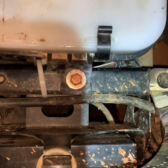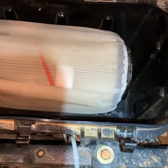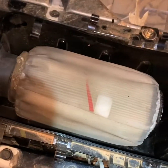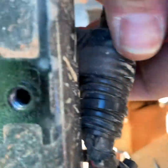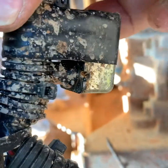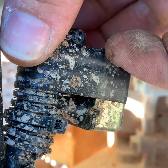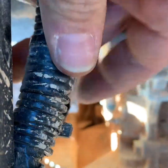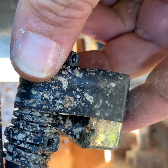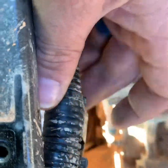To get to your circuit breaker, it's right in here behind the battery. Take off your air filter cover, then you have those two bolts — one there and one there — take those off and it just lifts up out of the way. I think I'm getting somewhere. I took the air filter housing out, and right here behind the battery is a circuit breaker. I'm going to get all this tape off here and check continuity between here and the relay. I didn't even know this was back here. I cannot find a wiring diagram for this 2013 Polaris Sportsman anywhere online, so I'm just having to dive in and see what I can find. Polaris absolutely loves electrical tape.